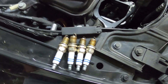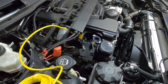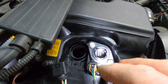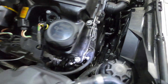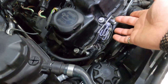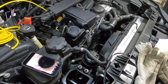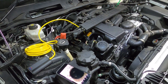I'm happy with that. I'll get some new plugs and stick them in. But really the main concern I had was this connector full of oil and the seal that goes around it. I'm going to order a new one of those because that's definitely where the oil was leaking down the engine - that's all the oil on the front of the engine coming from there. Covers are back on with silicon - just put a couple of dabs in those corners. Hopefully it'll fix it, otherwise I'll be ordering a new seal, doing this all again, and maybe changing the motor once we've got the diagnostics.